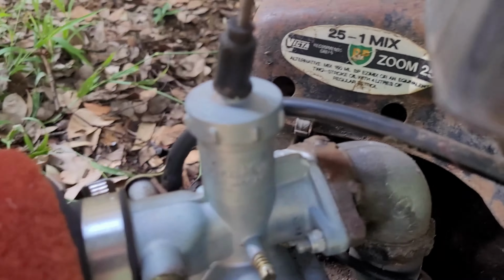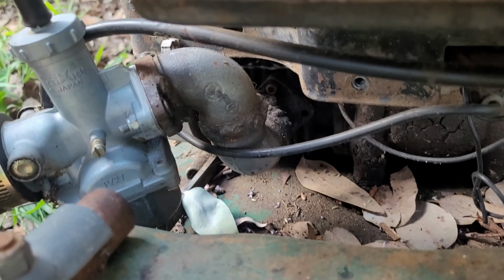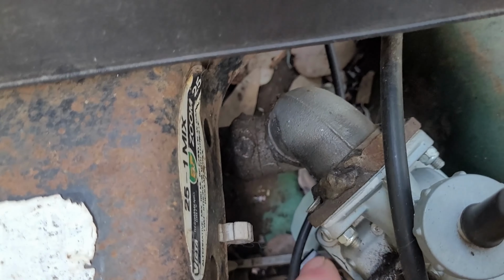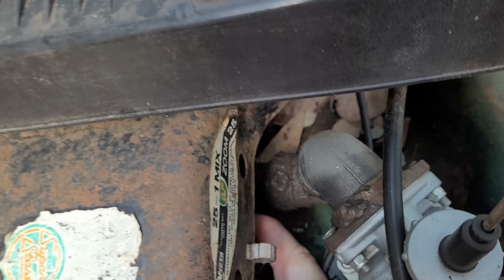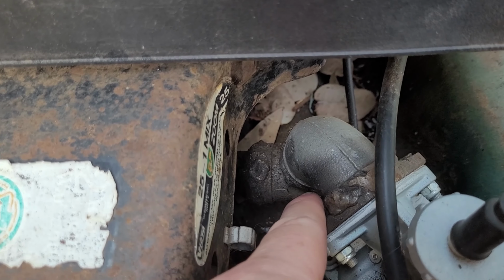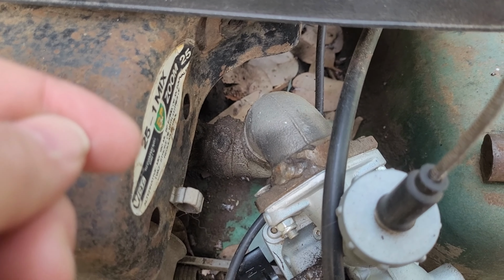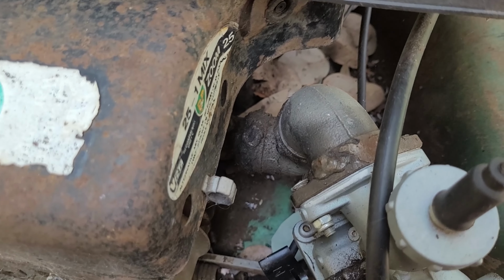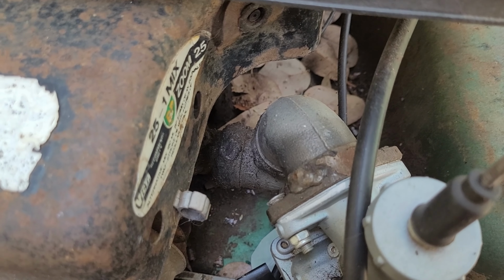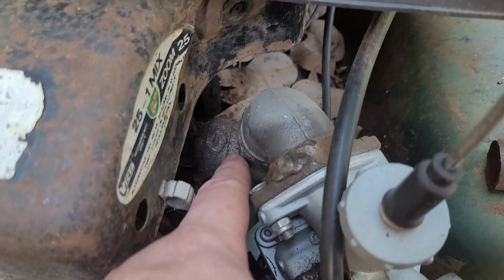You might be able to see in there, that is not the crusty welding fitting that I tried to do previously. That is a couple of pipe elbows that I've welded together. Come back over here, you can see a bit better. I managed to salvage the two manifolds from my original attempt at making this. The welded version was just not working, so I decided to make it out of two elbows welded to the mating manifold parts. This thing runs pretty solidly, and the videos of it running will be in this configuration.